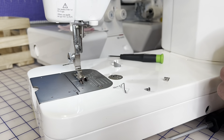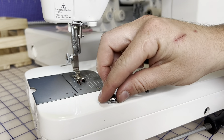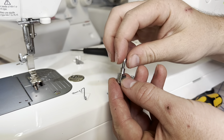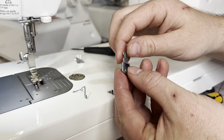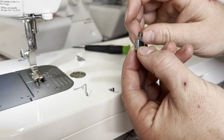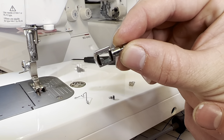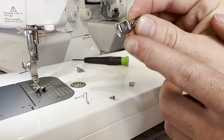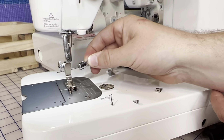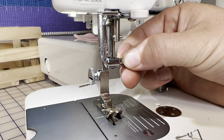Now that I have everything disassembled, I'm going to show you how to put everything back together. We're going to put the needle clamp assembly back together. Put this big flathead screw back in here — just make sure it's about halfway in, or until you can't see it going through the middle, so you can screw it down almost all the way. You can see there's a little ledge inside — make sure that ledge is on the front bottom left when you put this on. Turn it flat and put it on — there's a groove on this bar and that's where the ledge goes into. Raise it up and then pull it to the right.